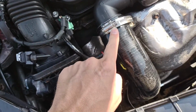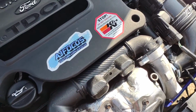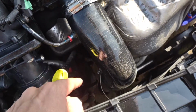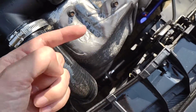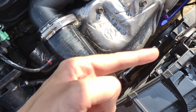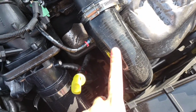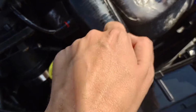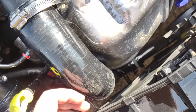So we need to take this pipe off. This is a hot side, so if you have one of these TDCi 1.6 Fiestas, you follow that side and you just need to undo it from here. And if you've upgraded your intercooler like I've done, the RS intercooler, you can go and check that out on my channel. These are upgraded silicone hose joiners all around, as you can see, stainless pipes everywhere. These pipes are slightly bigger than the OEM ones, so more free flowing.